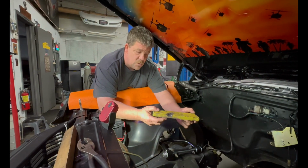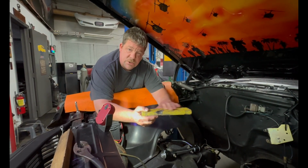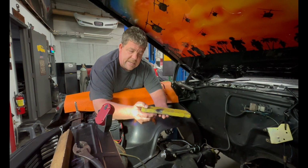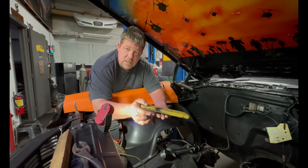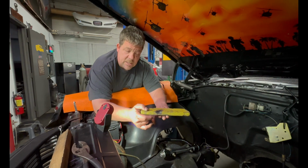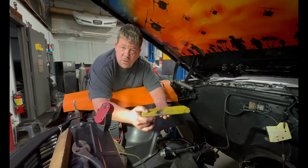So, in correlation to that, if you have negative camber, see this is flat, this is your tire on the ground at 0 camber. Now if you go to negative, it starts pulling the tire up. As you can see, right here we've got a gap, but when you go faster into turns and cornering, because it lays the tire down more, it gives you a little bit more speed you can go into the corner with.